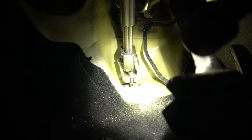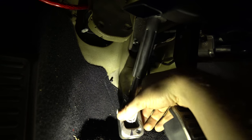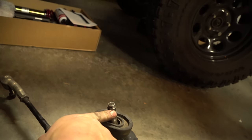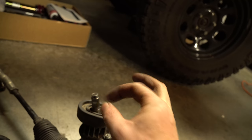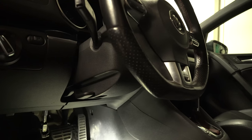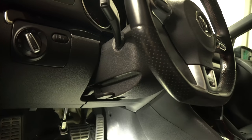Take out that 13mm. Now you would just grab this, lift it off, and put it off to the side. Just leave this here. Also, after further inspection, you'll see there's a round part right here — I'll show you on the other one — this round part is where your bolt goes through, so that way it lines this up perfectly when we put it back in. Once you slide this up and out, something important to note: don't start turning the steering wheel. If you do start turning it all different ways, you could screw up the clock spring.